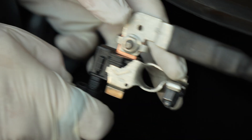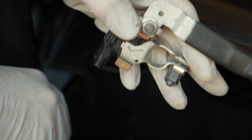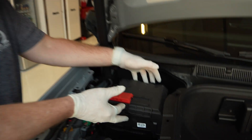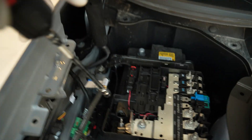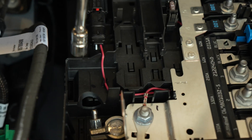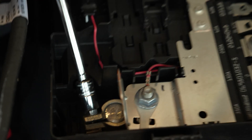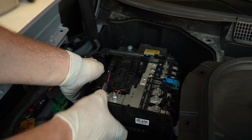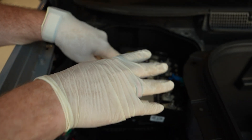There's a little connector on the side for the shunt that monitors current going in and out for the car's sake. Unlock that connector and remove it — that allows you to move the cord more out of the way. Next, we will disconnect the positive by removing the top lid. There's a 10-millimeter socket for that. Once we have this lug loosened, we can detach the clamp on the side of the assembly that clamps it down to the top of the battery, and then just let that sit loose.